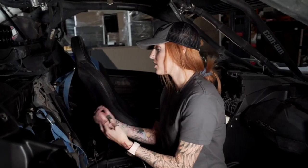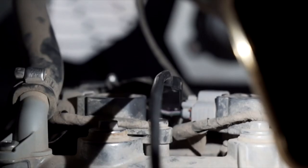With the back panel removed, you'll see the coil packs on top of the engine. Pick one of the orange wires coming out of the coil pack to attach the ignition sensor to.